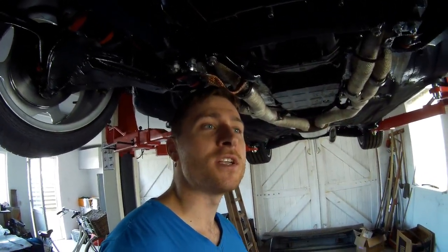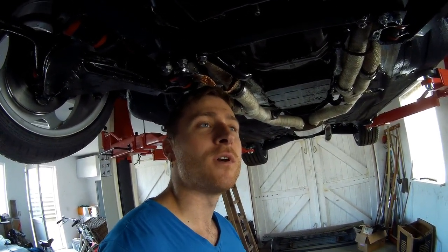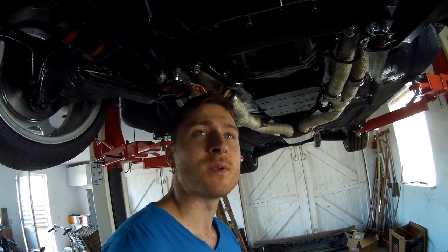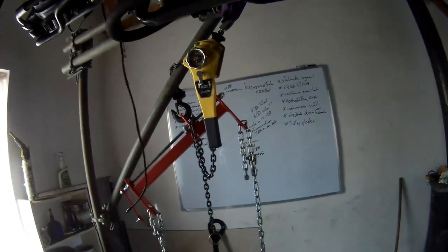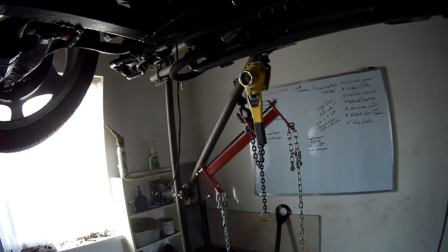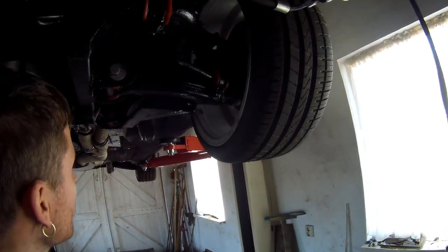So that's 2 centimeters, and the complete dipstick is about 5, I thought. So that will give me enough play to have my focus on the engine when I'm going to start it for the first time. So what I did with the transmission cooler is the only one that's empty. So I got the radiator completely filled up and the oil system completely filled up. The steering box was going in about 800 cc's to 1 liter. So that's all filled up.